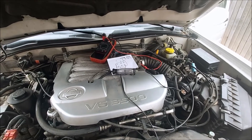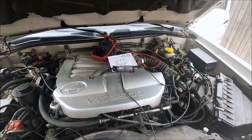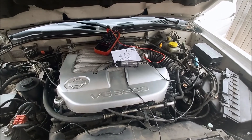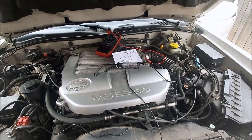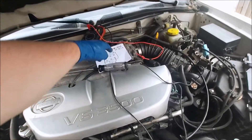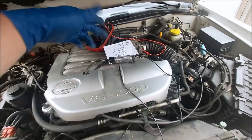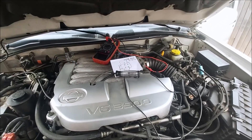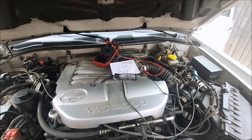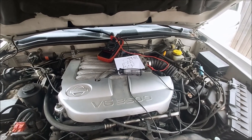I've already pulled out my computer and looked at the chip that usually gets fried when the IAC goes bad, but it didn't look fried — everything looked pretty clean. But we have a short anyway, so I'm going to open it back up, change the chip out, and see if that fixes the problem. I found all this information from Scanner Danner — he has a great video that breaks down exactly what to look at. This is just my particular problem. The other way this could go is one of these wires would have zero voltage rather than mine having a steady 12 volts. Check that video — I'll put it in the description.